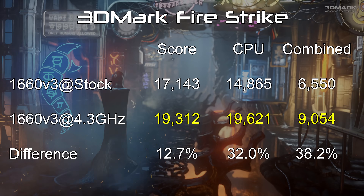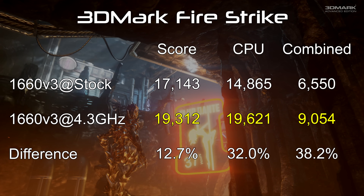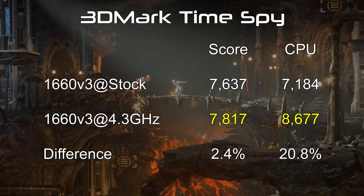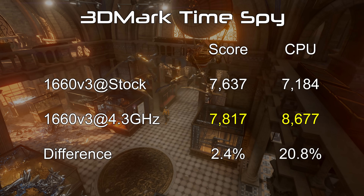Why do I call this a power sucker? It took 185 watts to run Cinebench at 4.2 gigahertz, and the Ryzen 7 1700? That's a 65-watt part. Even with the performance per dollar kind of tanking with those results, I did go ahead and run this through 3DMark Firestrike and TimeSpy just to see what a difference the overclock made. Firestrike went from an overall score of 17,100 at stock speeds to 19,300 under a 4.3 gigahertz overclock, with a full 32% gain over stock speeds. TimeSpy shows similar yet less impressive results, jumping from 7600 to 7800, with the CPU score leading the charge at a full 21% improvement over stock clocks.